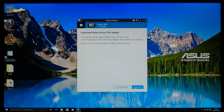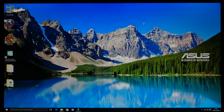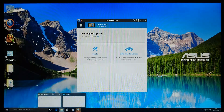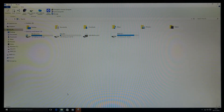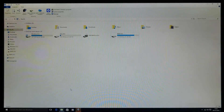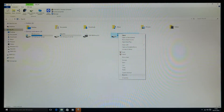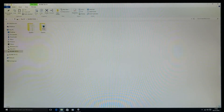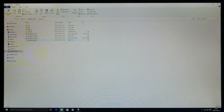Let that run. When it's done, go back into This PC. Your SD card — which I've labeled 'blank sd' — should now have two folders in it: one is your Garmin folder that you created earlier with just the garmin_device.xml in it, and the other should be a '.system' folder that's got a load of files in it — your maps, terrain data, and everything else.